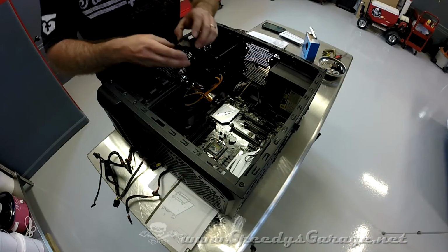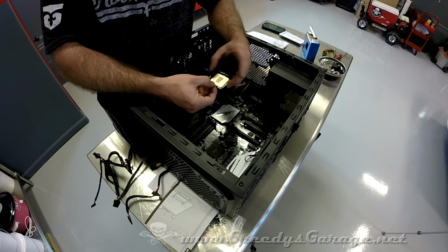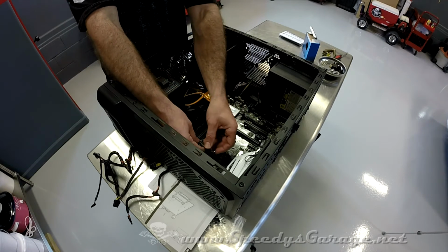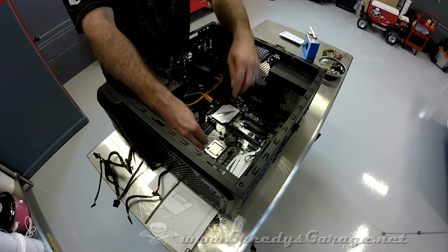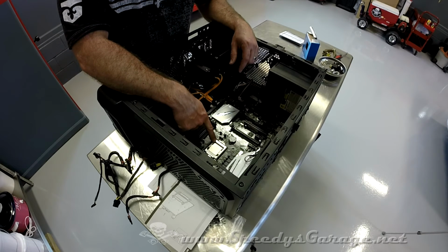And then insert your CPU into the motherboard. And you'll notice there's a mark on the motherboard denoting where the triangle should go. And finally, lock down the holding clamp. And as you're securing it, you can remove the cap. Make sure the holder goes underneath the set screw and lock it in place. And you'll notice the installation tool stayed with the CPU and the motherboard.